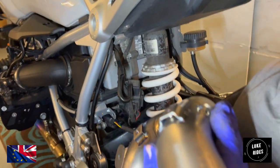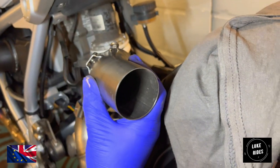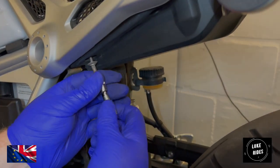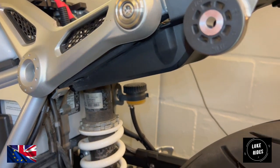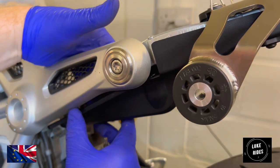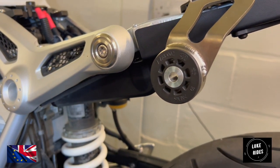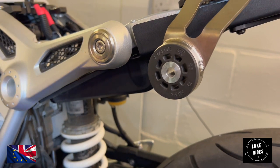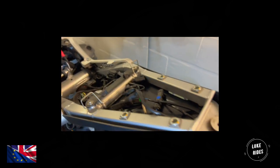And now we are lining up the link pipe and seeing what we're going to get. Just removing the lower T25 screws and I'll see if this unit moves. It does. I may have to release the two on the other side to get a little bit more room before I can slide this up and under. Nice tidy alignment.